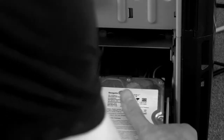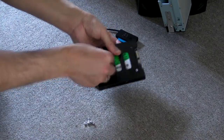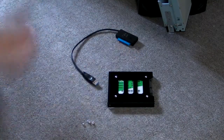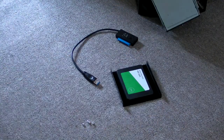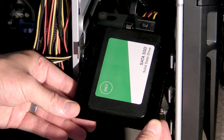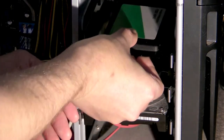Now unplug your old hard drive. To fit your SSD snugly in your case, you can screw your SSD into a mounting bracket — it cost me less than $5. SSDs have no moving parts and aren't as sensitive as old rotary hard drives, so the mounting tray is optional. Now plug in your newly cloned SSD's power and data cables, slide the tray into place, and you're ready to go.